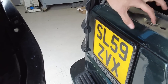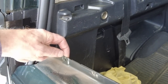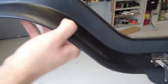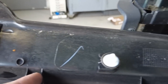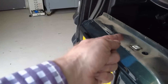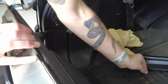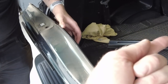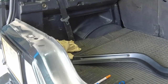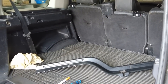So there are two white pointy clip things, but that's just the cover - no wires coming out. Now make sure you find all those screws - lower the tailgate, there's one jammed in the carpet. Make sure you recover all four of those screws. When you put them back, don't put them back in the carpet but put them back onto the holders on that plastic piece. We'll collect them all neatly in a pot.